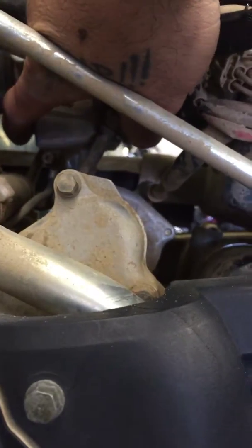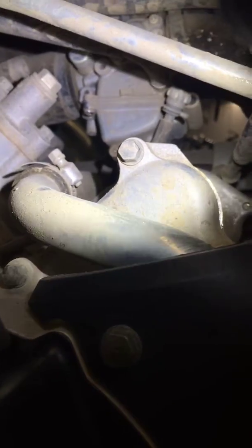Hey Kirk, this is Ryan here. G-Force is gonna go over your grizzly with you on your running issue. I'm almost positive that's gonna be your carb. If you look up underneath there — it's kind of hard to see — but there's a spigot that comes down right in the center, right behind my finger. You can see there's a plug in the bottom of that, and with that plug still there, it's showing me that it has stock jetting and it's never been jetted for altitude.